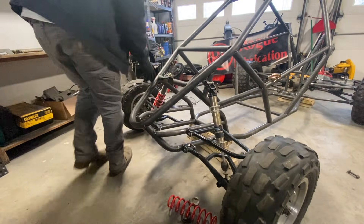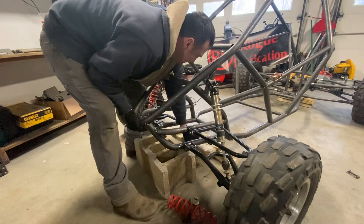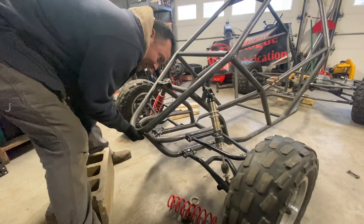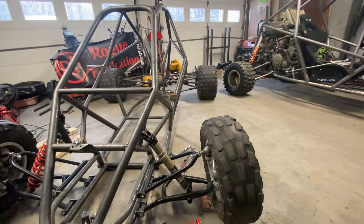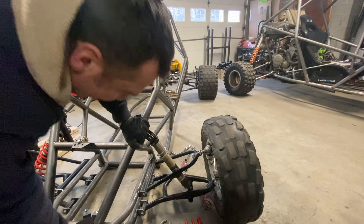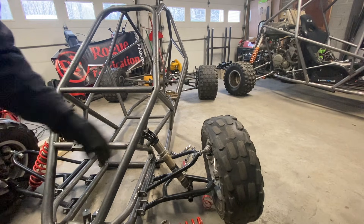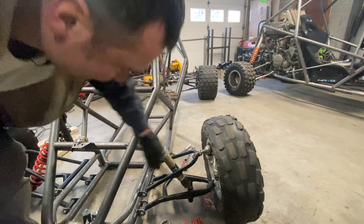Spring is off, make sure the other shock is out of the way — we're only going to do this with one shock. As you can see, it's right on the bump stop as it hits the ground. So we are going to need to lower it, but that creates problems — we're going to have to loosen up the spring so we still get our five inches of ride height, or we might want to start looking at swapping it for different shocks. So close — literally within a quarter inch.